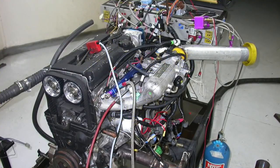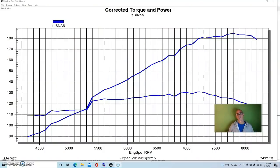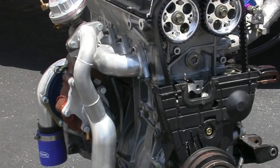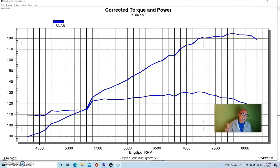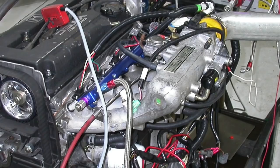To get things started on our Honda power adders, we'll start with nitrous. Although nitrous might not be as common with B-series Honda stuff — most guys tend to go turbos — we're also going to be looking at supercharging. This was a basically stock B16 run on the engine dyno at Westech. It had been lightly modified: stock bottom end with ring gap, head studs, the head milled about 30 thousandths, and adjustable cam sprockets — but with the stock P30 cams, unported P30 head, stock pistons, rods, P30 intake, and throttle body.